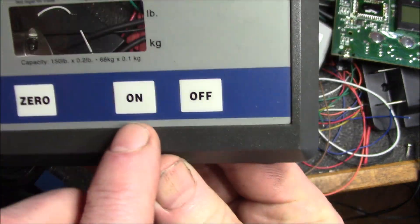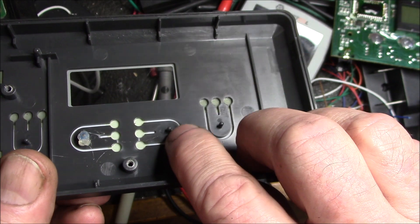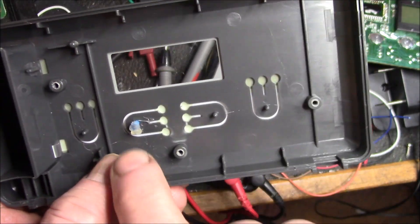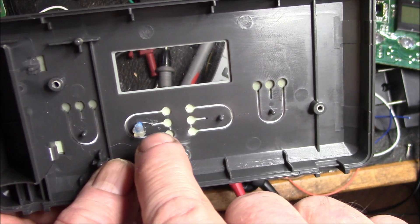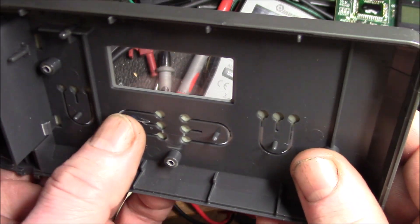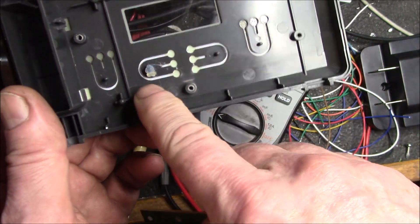This is the on button. The way it is set up originally, it just has this little plastic pin, and as you push the button it pushes that pin down. So what I did was I took a small piece of heat shrink tubing, put some hot melt glue inside, and pushed that over here. Then I built up the end so it's just bigger — the idea is I just want to have a bigger push area on that tactile button.